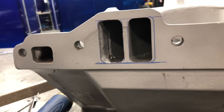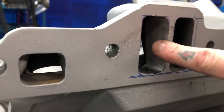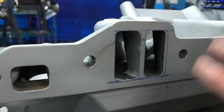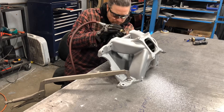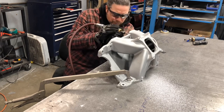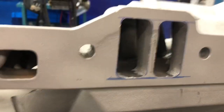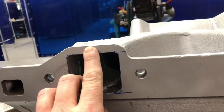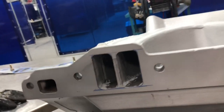Got that first port roughed out — out to my line, brought the grind in quite a good ways, and got into the turn on this one. I really like how this one's coming out right into that turn. After I'll go back and clean them all up with a sanding roll to smooth them out. Not sure on the complete final finish yet, but that's looking like a real good start. Here's one side roughed out — I'm pretty happy with how it's turned out. I'm really working to get in and around those corners nice and smooth and took a ton of material out. I'm going to switch over to the sanding tool now and smooth out my die grinder marks.